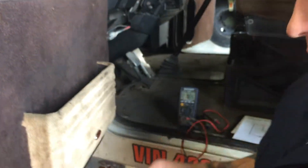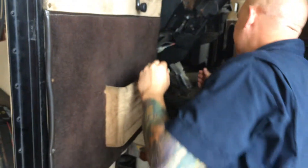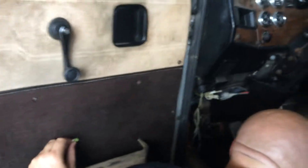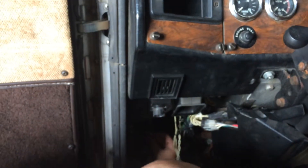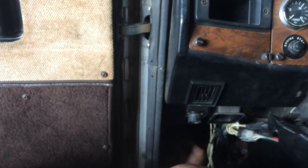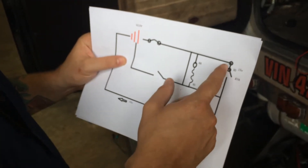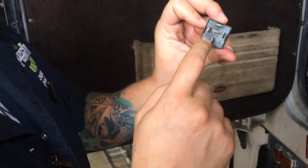Now from here, I'm going to turn my headlights on. I'm going to remove the relay. I'm going to jump the relay using this jumper cable right here — what I'm going to do is put power through the circuit. In the diagram I connected power to the relay, which then closed the relay right here. So now I have power going from 30 to 87. As you can see on the relay, this is 30 to 87 right here. I just jumped that in the electrical circuit.